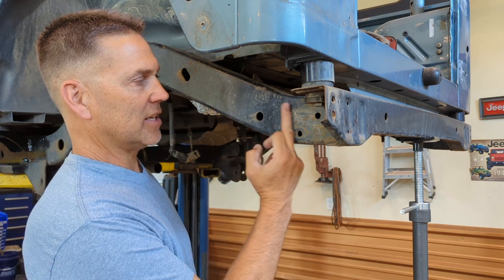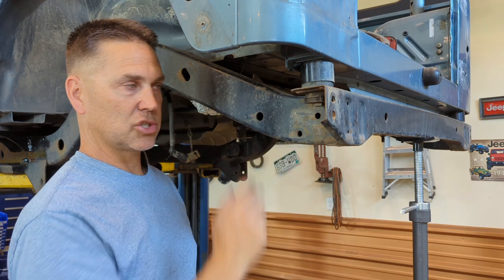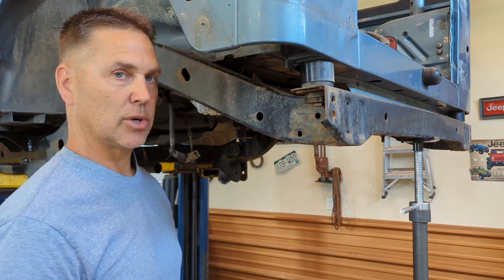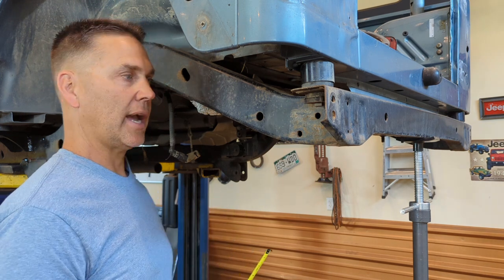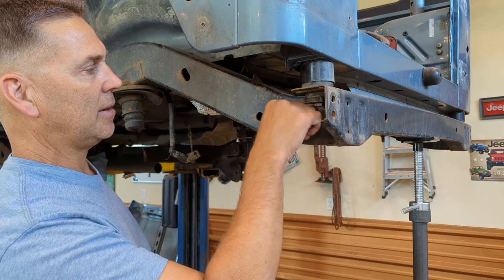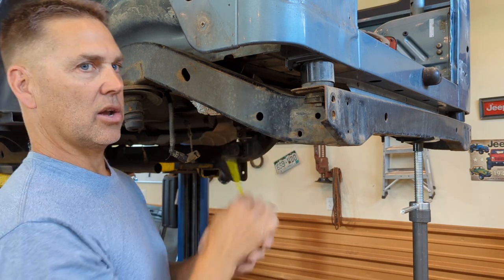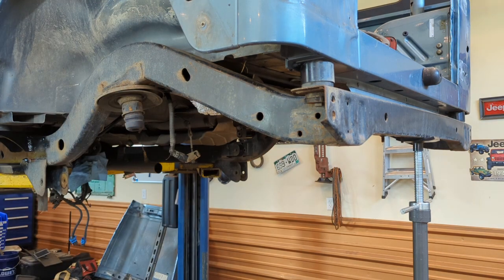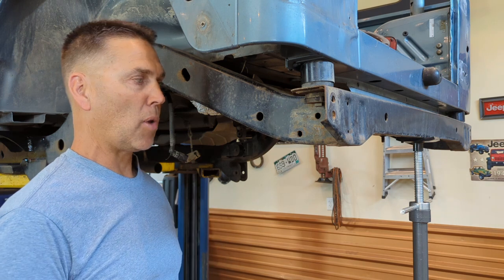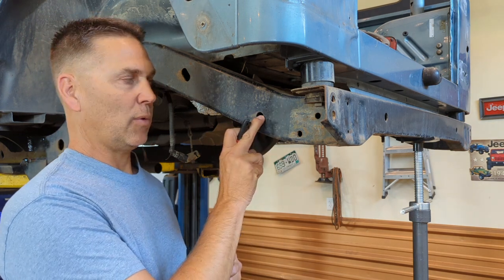Where you make your cut in this area isn't as critical as making sure the cut is in the same direction as your body mount bolt. Note: if you have an LJ, that's the exception because LJs have an additional cross member back there, so take that into account. It might seem easy to just mark one inch with a tape measure, but keeping that mark consistent on a line could get off a little bit, so I created a small custom tool to get repeatable marks on all the points I'll be cutting.